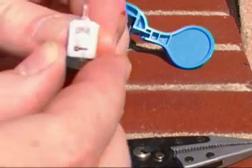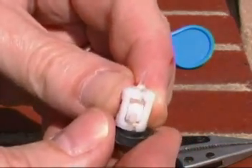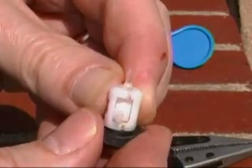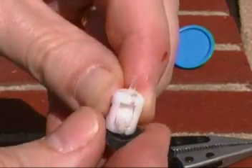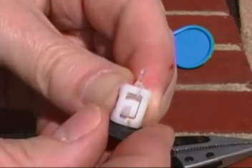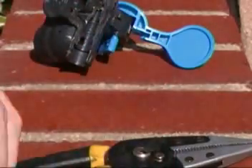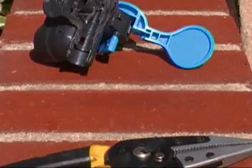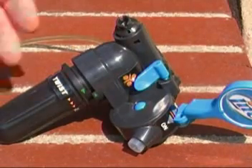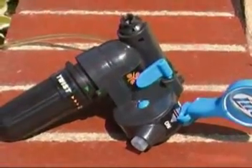Here's basically what's going on to regulate it: you've got a spring on either side — one spring on the inside pushing to close it, and the spring on the outside pushing to open it. So if you've seen my other video about how to force carbonate using Miller Home Draft, you can see that when we push up here we're opening the valve, and when we let the springs do their normal work, it closes the valve. So there you have it — a destructive test of the Miller Home Draft unit showing how it works. I hope you enjoyed it.